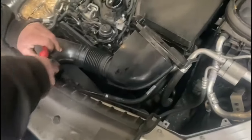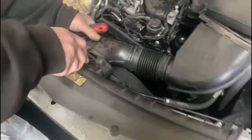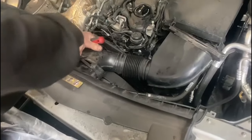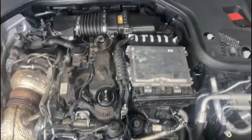Now when taking these small plastic bits off, especially in cold weather — right now it's around 1.5 to 2 degrees — we've got to be extremely careful as they're easier to break in the cold. We've got to get these small plastic tabs soaked in WD-40 as we don't want to break anything in the process. They are difficult to take out, so we go slowly.